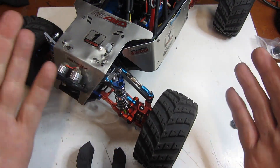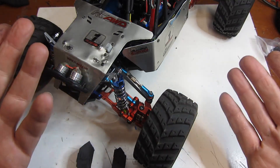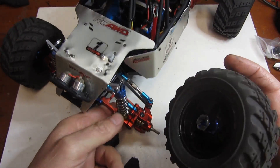Once you lock that down, you have all the clearance that you need — that's the main reason you would need hub extenders. You can also just put them on if you want because they obviously look cool. They widen the stance, which lowers the center of gravity and helps keep it from tipping over, so those are all obvious advantages.